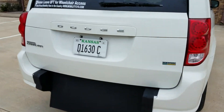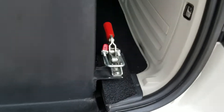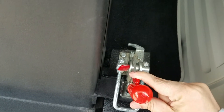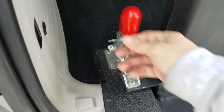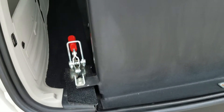This is a rear entry, manual ramping door. Very easy to operate, very low cost to maintain. It's got the manual trunk latch. I can operate this entire conversion using just two fingers — I pinch here to get these clamps up. There's one on each side. I really like this design; it keeps these ramps from rattling around in the back. If you've ever been in an older mobility van, you hear the ramps rattling all the time — it is super annoying. This actually prevents that.